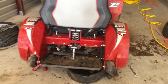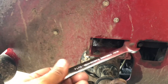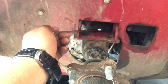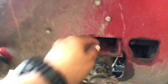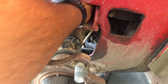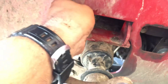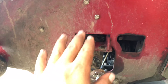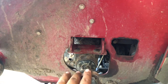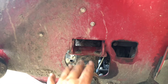It's pretty easy — the hardest thing is just these bolts right here. If you've got smaller hands or some kind of wrench you can get in there, and once you loosen it up a little bit you can get it with your hand. I do recommend that once you pull those out, check the o-ring — there is an o-ring on there. Make sure it's not damaged before you put it back in, just so you don't have to deal with a mess later, because it's hard to see if it's going to be leaking down the road.